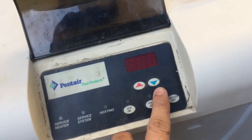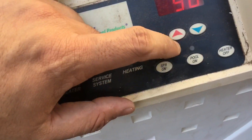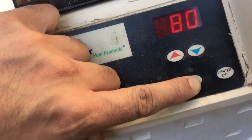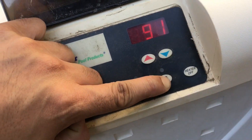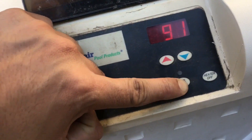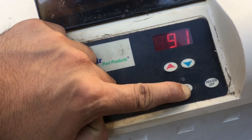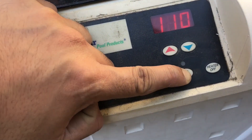Let me go ahead and put the cover back on, plug it back in, and you're good to go. Now that we've replaced the Stack Flue Sensor, let's do a quick test. Let's see what it looks like — it's actually heating now, reading 91. Make sure the temperature is going up once the igniter kicks on. 99, 110 — perfect. That's our exhaust temperature, so we are in business.